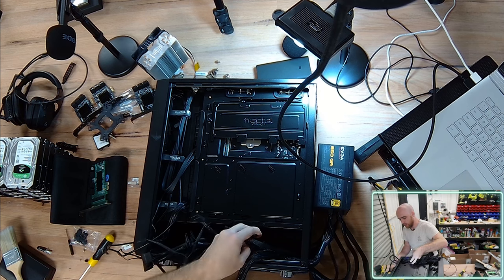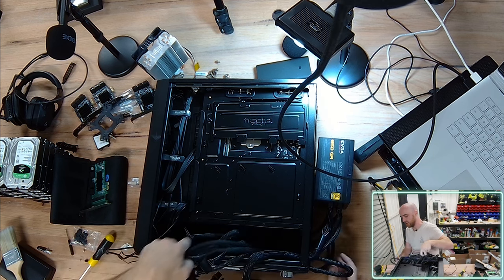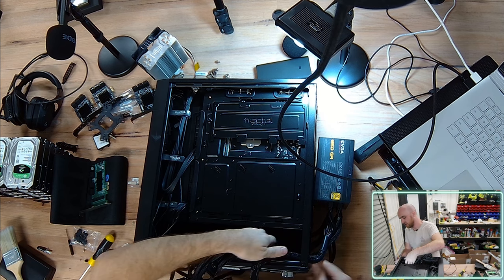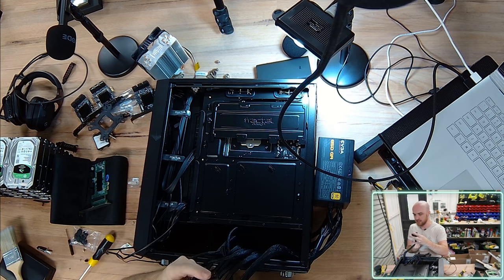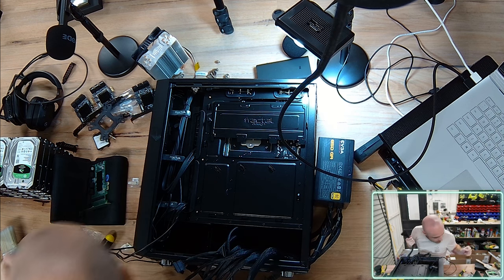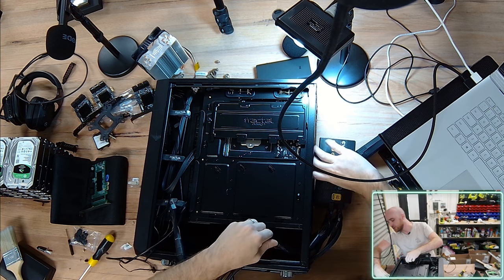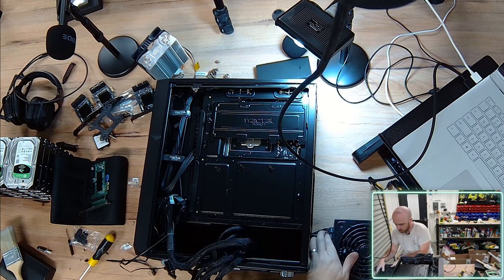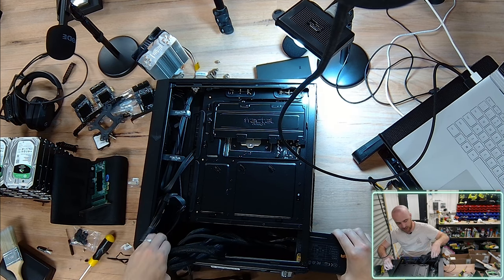I just need to look into what my options are to get all these hard drives online. Potentially I could just have a dedicated power supply sitting off to the side, which is being relay triggered, or just simply has a stopper on the end here, which has a jumper. Essentially, you can get little motherboard power connector caps, and those caps have a jumper pin in them, and those jumper pins send a command to the power supply to turn on. So you're jumping the power switch. So that is an option that I have.